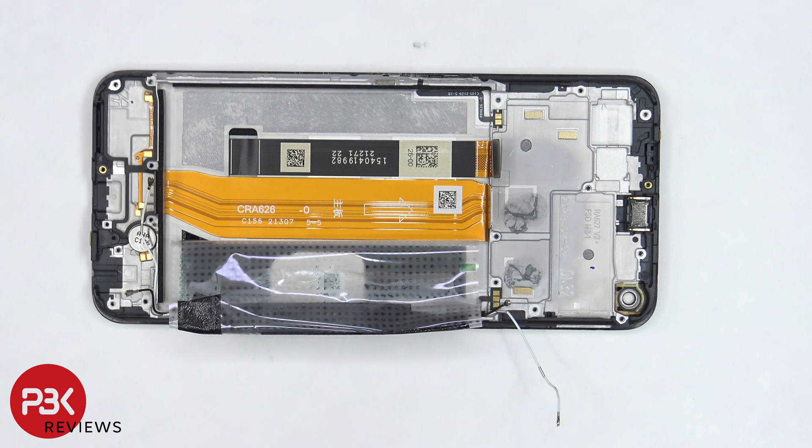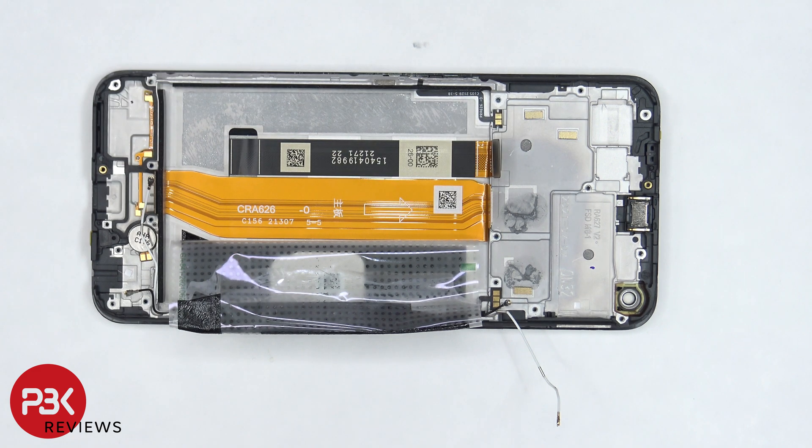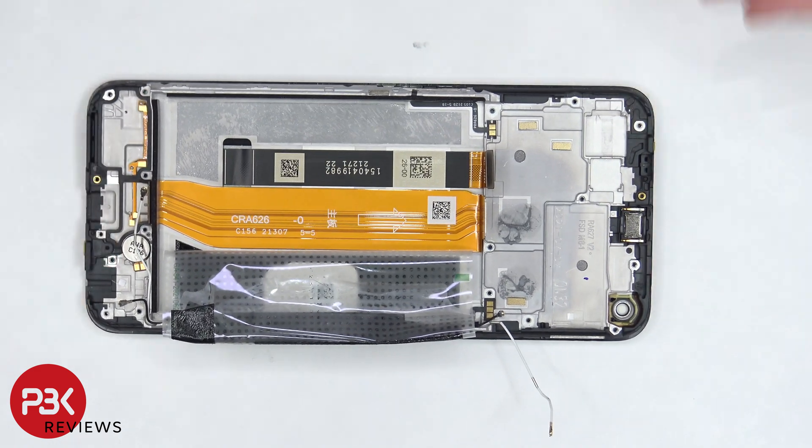If you needed to replace your screen, you would have to remove the back plate, as well as the screws on the back housing, and remove the back housing itself. Disconnect the battery cable and the screen cable, and then you would have to pry the battery off. Heat up the front of the phone where the screen is, so you can loosen up the adhesive underneath. Pry your old screen off, apply new adhesive, reapply your new screen, making sure you run the cable through the opening in the midframe, and then you reassemble your phone.